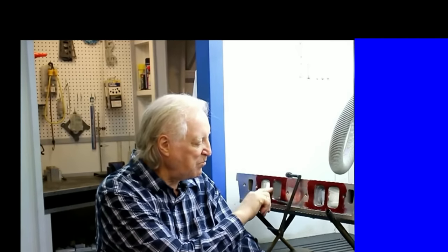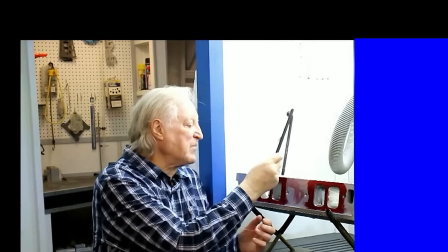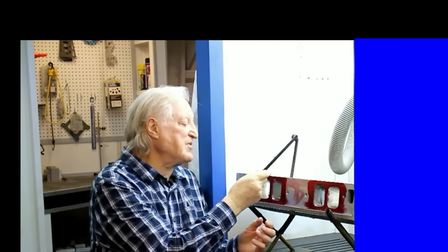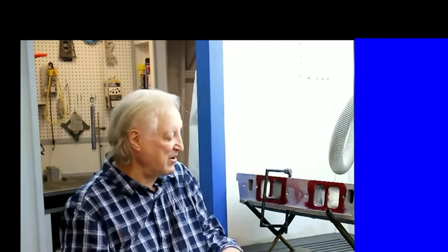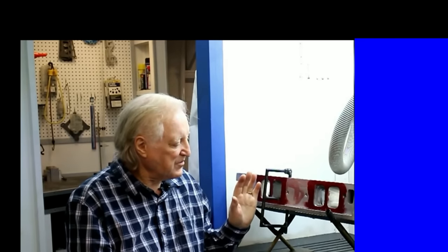What I'm doing at the moment is checking the port wall thickness to the push rod hole using this Helgeson E&I bar. This is an easy thing to make in your own shop or at home. It allows you to get the push rod wall thickness to the port very close so you don't break into it, avoiding having to fill with epoxy or getting it welded. We'll see this tool in action here.